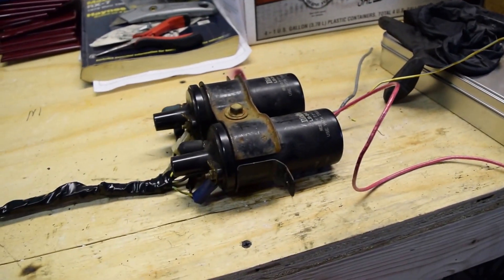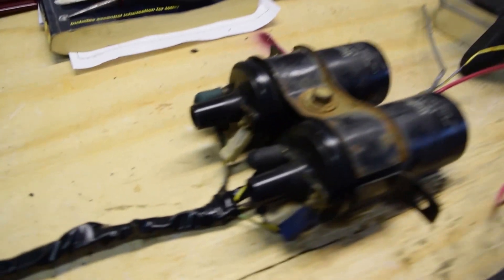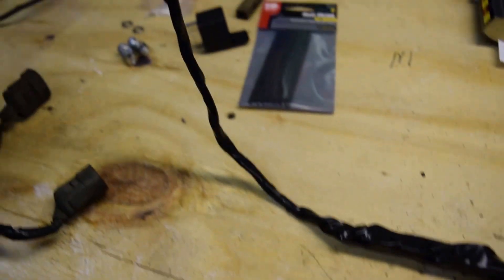The stock 12A ignition system in these cars is extremely simple. It basically just runs a power wire, which is a stock black and white wire in here — pretty thick wire, about a 12 gauge wire — that powers the coils and then runs down the length by the spark plugs just like this.